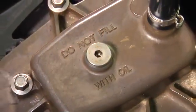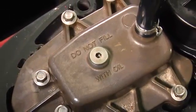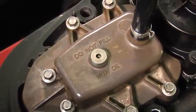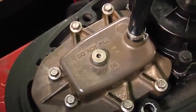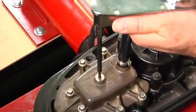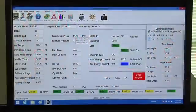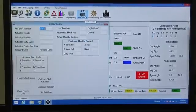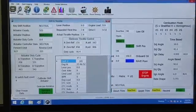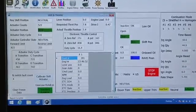Make sure the gasket is installed on the plug and the plug is tightened securely. Water intrusion into the shift actuator cavity will damage the shift actuator. Torque the plug to 60 to 84 inch pounds or 7 to 9.5 newton meters. After the gear case is reinstalled, use Evinrude Diagnostics 6 to check or recalibrate shift actuator operations.